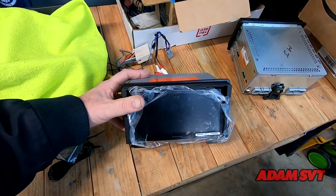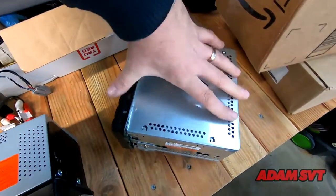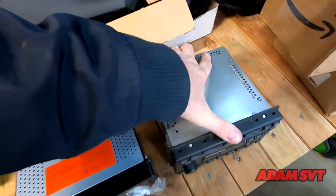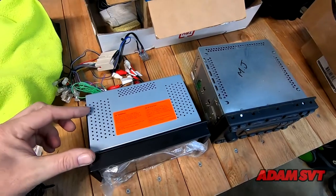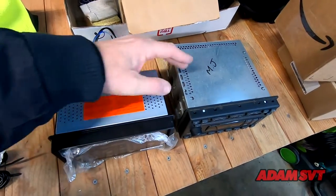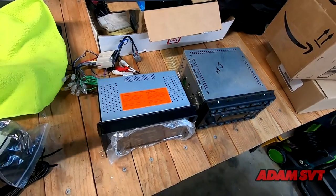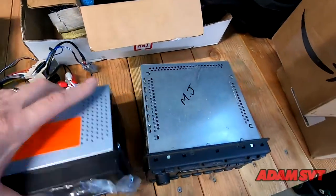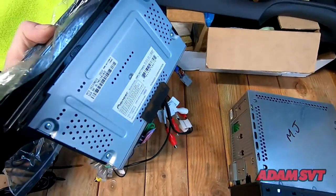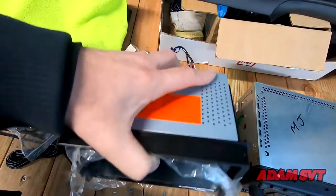Here is the unit itself in the same Metra kit I used with the Kenwood. Spinning it around, it's definitely longer than the Kenwood barrel — I don't think the Kenwood even cleared the bracket. You can see it's not quite as long as the stock unit, but it does come out further. When I popped it in there it moved very little, so I just put a small piece of foam on there to replicate the OEM bracket, and it seems to be perfect.